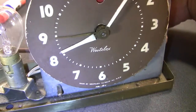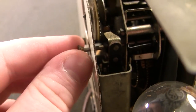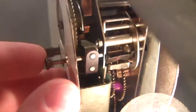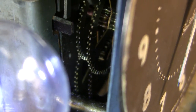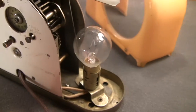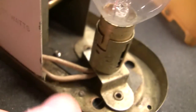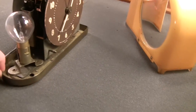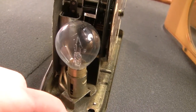Now I'll go ahead and get the alarm to trip. You can see that's the buzzer mechanism right there, the one responsible for making that noise. I find it pretty amazing that a clock of this vintage still keeps perfect working time. It just uses a very simple 25-watt bulb — though apparently somebody thought it was a good idea to put a 50-watt bulb in here. They used a 50-watt GE bayonet-based bulb, probably an appliance bulb. But this recommends using a 25-watt, so no wonder it gets a bit hot and is extremely bright.